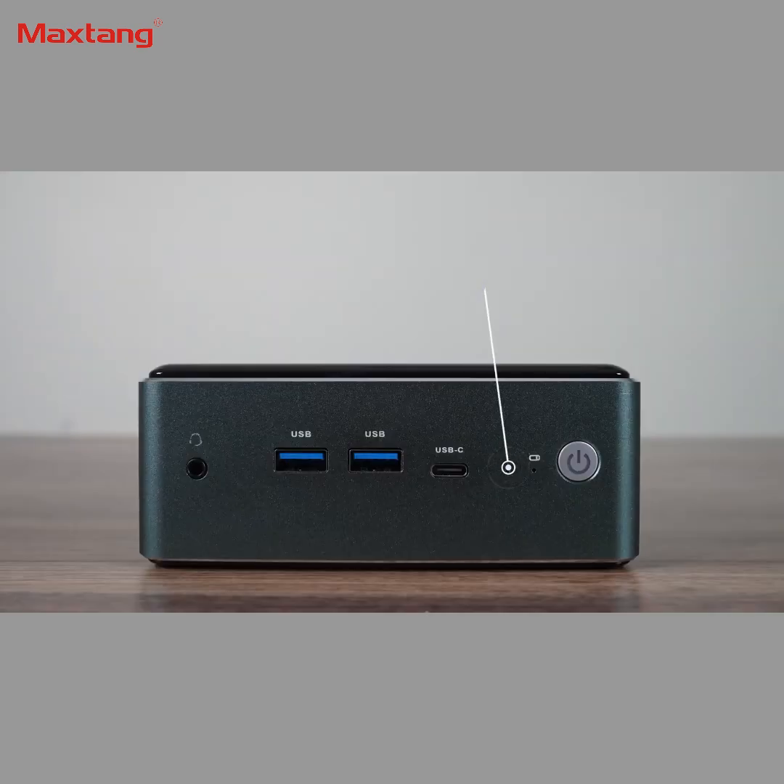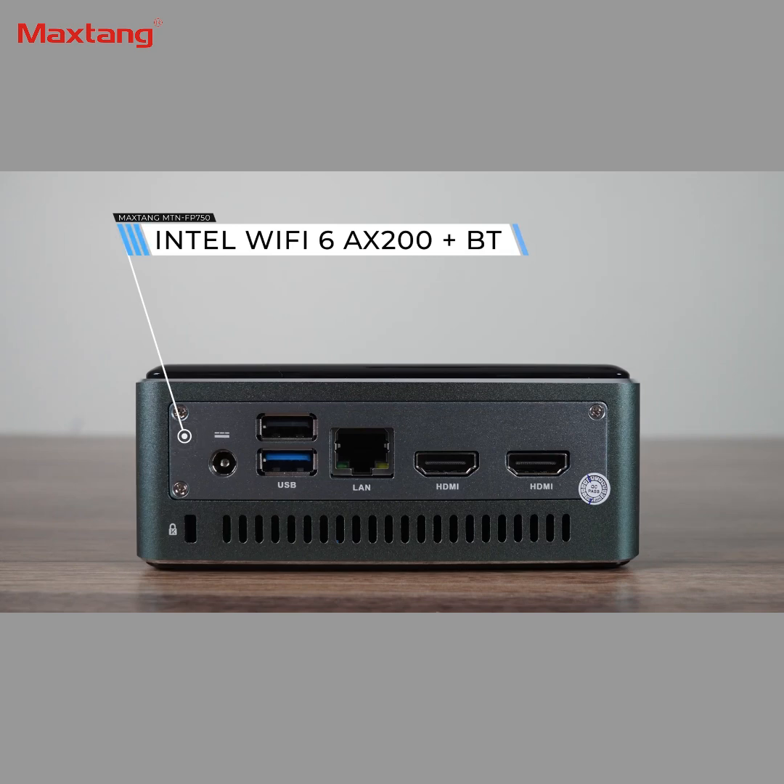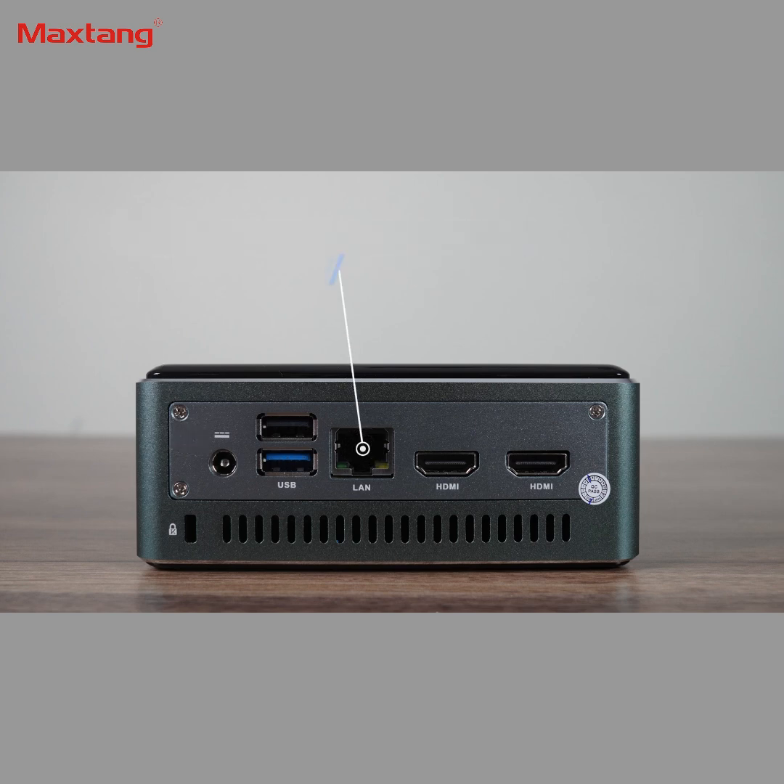The port selection is pretty meager. There are five USB ports in total — one is USB-C, which supports display, but was not able to power the mini on using my USB-C monitor. There's also one USB-2, and the rest are USB-3 10Gbps. The USB-C, together with the dual HDMI, allows for three displays natively. There's also a Realtek 2.5 Gigabit LAN jack. If you do get the WiFi card, it's Intel WiFi 6 AX200.